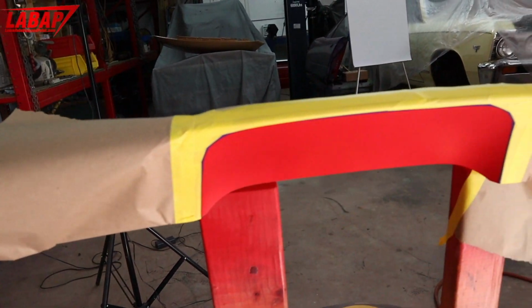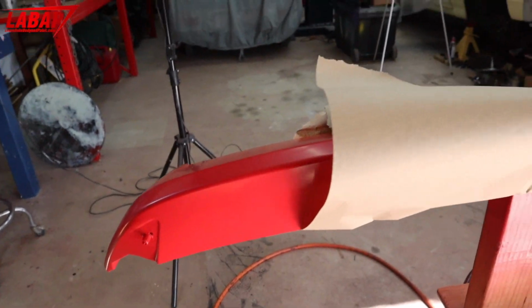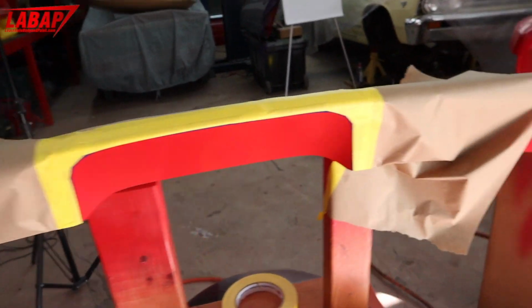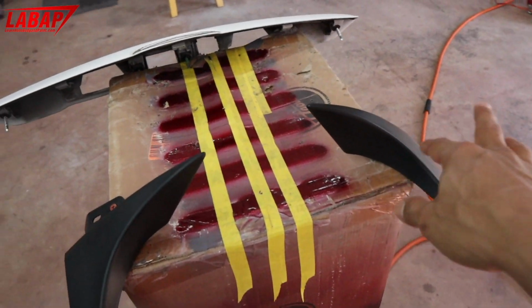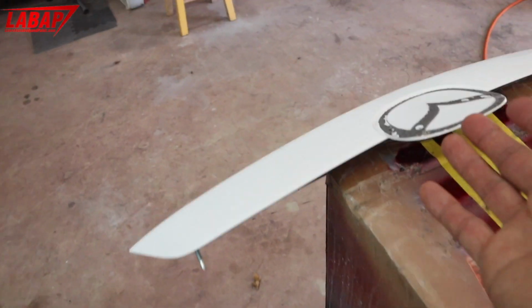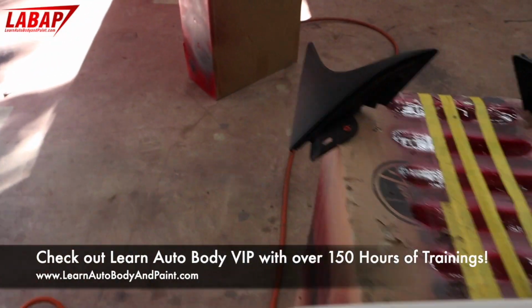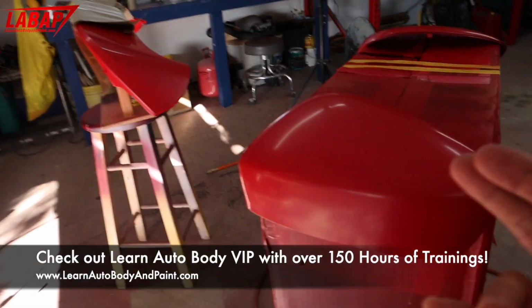All we're going to do is dust this area. If we do get overspray on this, it'll wipe right off with the tack rag. It's not a huge deal, okay? We're going to spray some quick adhesion promoter on these bare plastic pieces, and then do our black base coat. This, we're just going to do black base coat. Once this is all dry, then we're just going to candy our red.